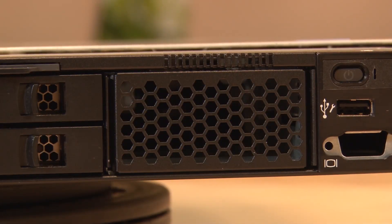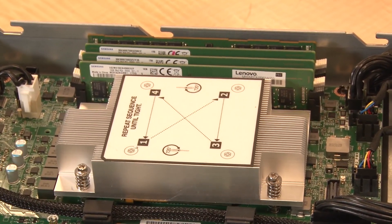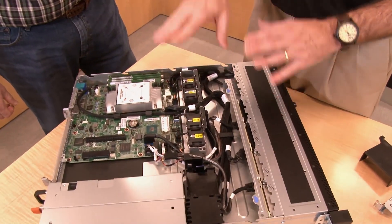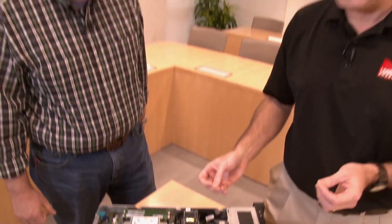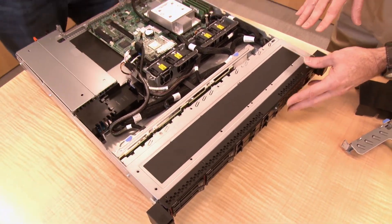The system supports NVMe drives, and the processor also supports SGX — Software Guard Extensions. The combination of high-performance NVMe drives and SGX makes this a really nice blockchain engine for customers wanting to deploy a series of blockchain nodes. The server also has a built-in Trusted Platform Module (TPM) for enhanced security. For China customers, there is a plug-in TPM module available as an option. A 1U security bezel is also available to protect physical access to the front drives, lockable with a key.